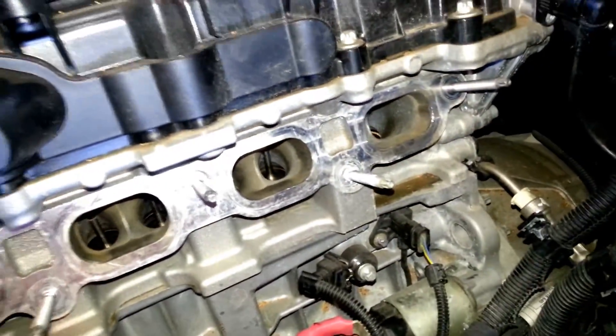It's better than that gunk. Anyway, these valves are clean. It's 30,000 mile maintenance — carbon maintenance, gunk maintenance, valve cleaning maintenance, whatever you call it — it's completed. Here's the intake for the N20. I blasted it clean, carefully power washed it. It was pretty much really clean, just a little oil residue in here. But now it's completely clean. I like to clean these intakes when I do the valve cleaning and port cleaning, because why not? You have it off. It'll keep these valves cleaner longer because you won't have that residual oil in here gunking up the valves after you have them just cleaned.